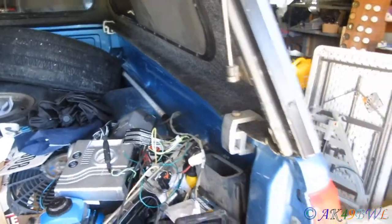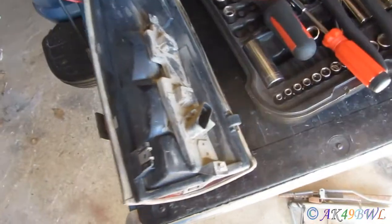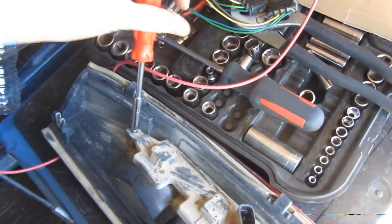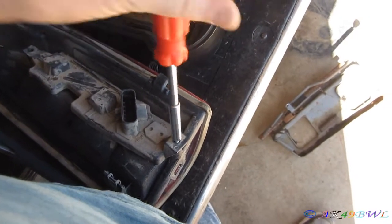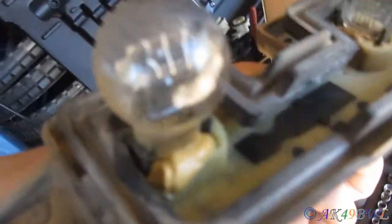It takes three 194 housing bulbs and I'm going to go ahead and get LEDs for them. The entire bed cover needs to be pulled off so I can reseal the bed line. The sealant is like coming out everywhere and all inside the bed the carpet is totally wet — soaked in fact, still wet even overnight. These things I really do not like right now because there's no way I can put LEDs in this housing without maybe modifying the LED bulbs themselves because of the way they are designed. Or maybe since the upper bulb only acts as a tail light I can just put a 3156 in there instead of a 3157 like it currently has.